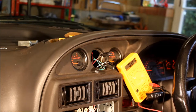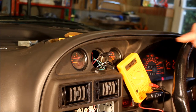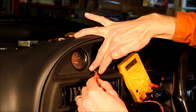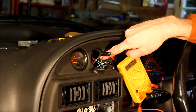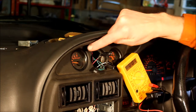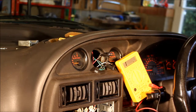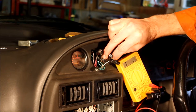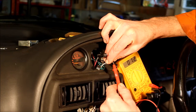To test wiring or the pressure sender, start from the gauge wiring. First, check for plus 12-volt power on the green wire with the ignition on. Set your multimeter to DC volts, clamp the black lead to a known good earth, and put the positive probe onto the green wire — you should have 12 volts. We're getting 11.7 volts, so battery voltage is present. Note that power for these gauges is daisy-chained, so if you haven't got power here you probably won't have your boost gauge or volt gauge working either. Next, test the earth: with the multimeter on resistance range and one lead to a known good earth, probe the black wire — there's barely any resistance, so the earth is fine.